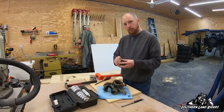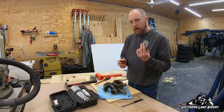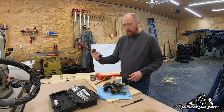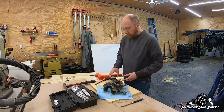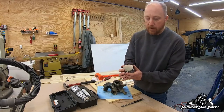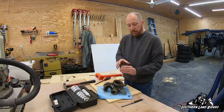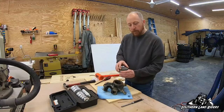The way we were able to do that is a couple years ago Ryan bought a tool very similar to this. I bought this one on eBay for 40 bucks — turns out I don't like it very much. Ryan's worked okay. It's keyed so that it goes in the hub like that, so you can pound it in with a hammer and get the bearing out. But the challenge is it's difficult to keep straight and make sure you're hitting it in the center so it's not moving all over — which is the problem when you're on the trail.